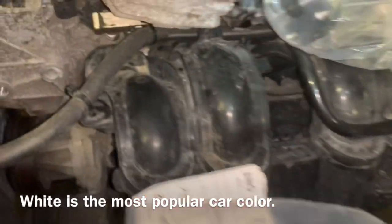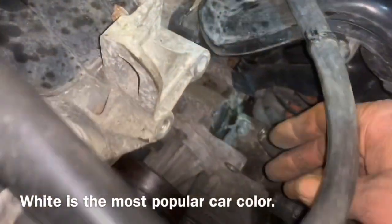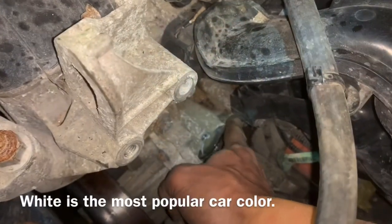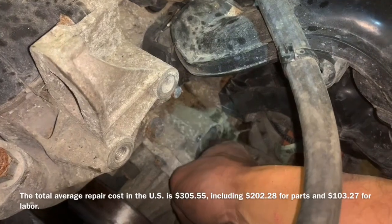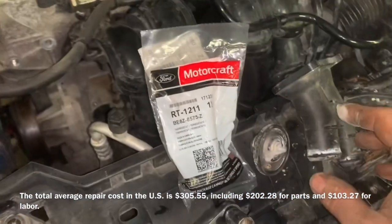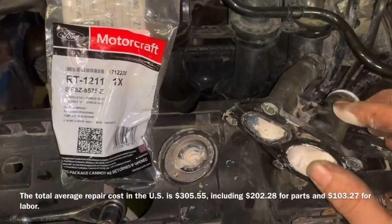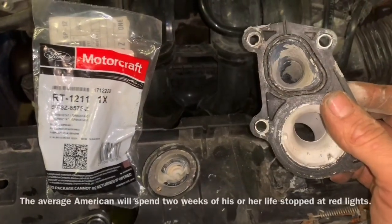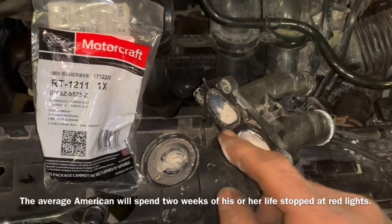In my situation I'm going to have to clean up both surfaces — you want to do that. Get some Scotch-Brite on these surfaces to get rid of some of the electrolysis and stuff on there, and then reinstall this. If you use silicone or Permatex to adhere this, more than likely you will create a leak because you'll create ridges that are unnecessary.